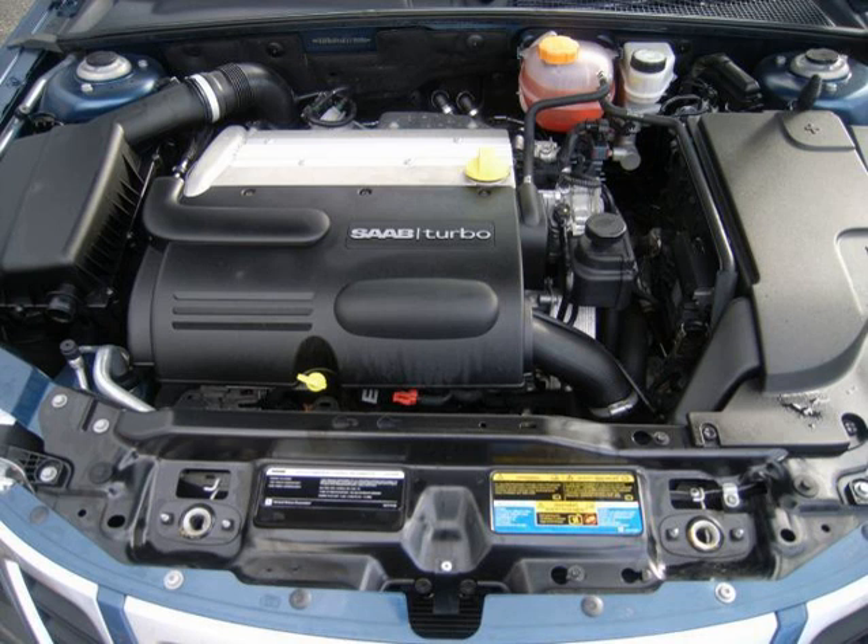A variant of the LCV features an intake valve lift control system providing two-stage variable valve lift in addition to continuous variable timing. Continuously commanded by the engine control unit, the valve rocker arm switches between high lift and low lift profiles on the camshaft, actuated by an oil control valve through a two-feed stationary hydraulic lash adjuster, allowing for either 4.0 or 10.5 mm lift. It also features a start-stop system. Maximum engine speed is listed at 7,000 rpm.